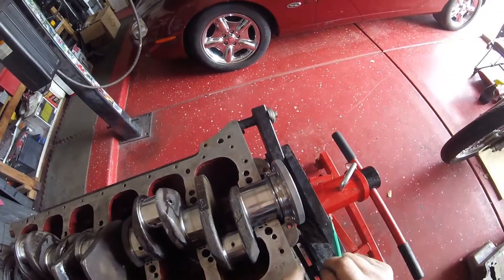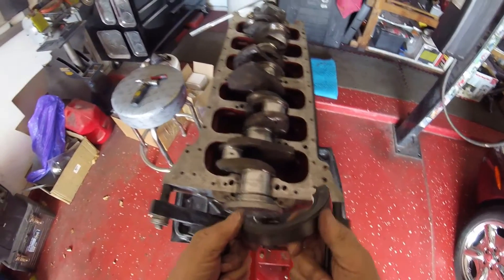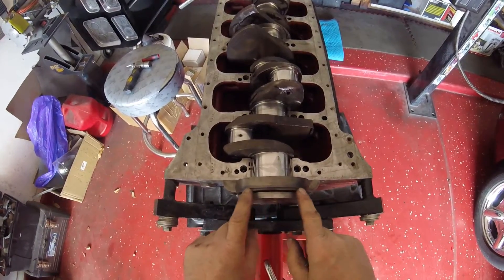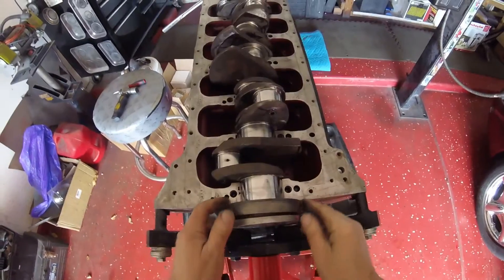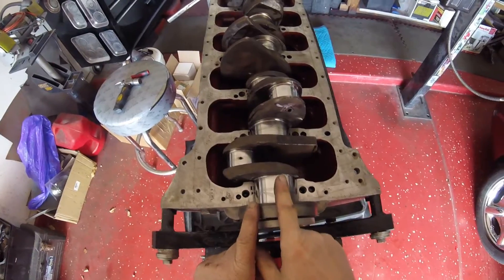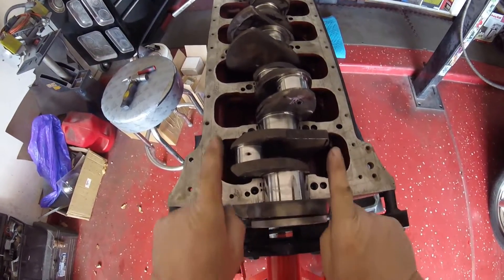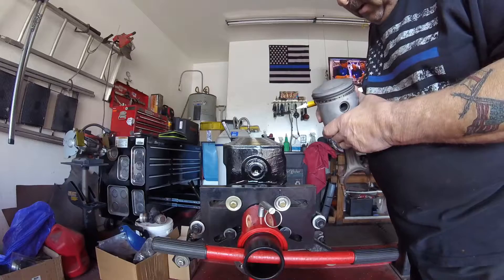Next thing is to put the piece on the top. Just a little FYI when fitting this piece: it can end up being fitted the wrong way - and that is the wrong way. This cutout here has to be on the inside. The reason being, when the cap goes on the oil will come here and go back in. If you have it the other way around it's going to cause you a problem. So just be aware that this cut-away piece faces into the engine.